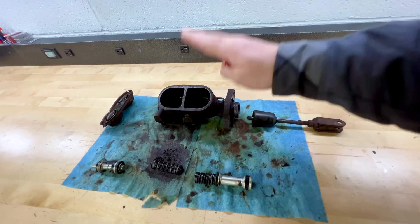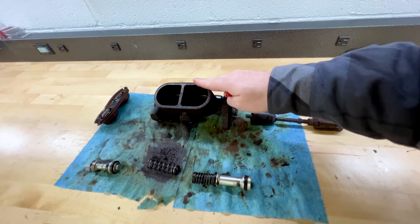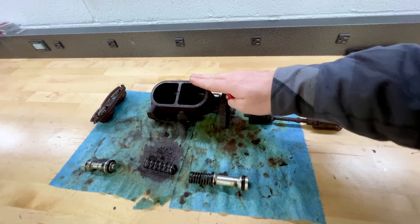The fact that this master cylinder is cast iron exacerbates this issue and really makes it much worse, which is why it's such a great example. Inside your master cylinder, wheel cylinder, and brake lines, that's all untreated raw steel. So you can imagine where we're headed with this — moisture gets into the lines, you have untreated raw steel.